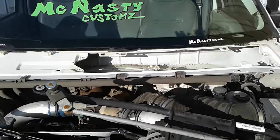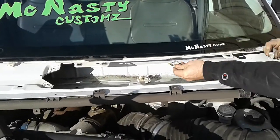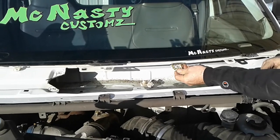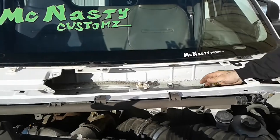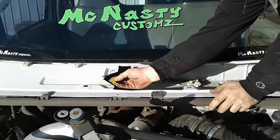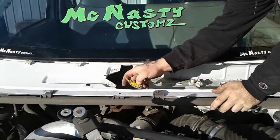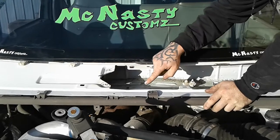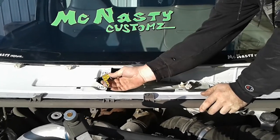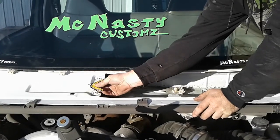There are two little small areas here that you're going to have to trim. This is where the cap goes — you just trim this one completely off. You don't need it. On some of the other trucks, you might also have to trim off this area right here to make a little bit of clearance when the arm comes around. Anything roughly in that area — roughly the size of my hand — that's all you trim off.